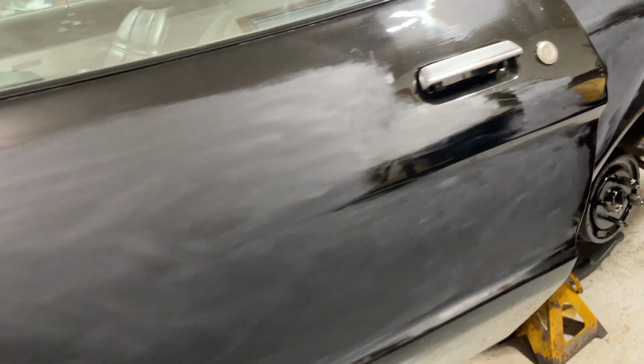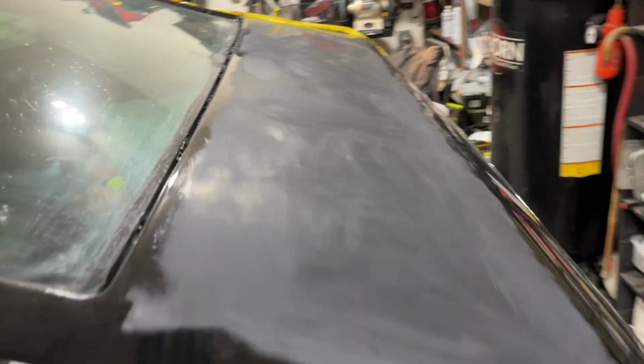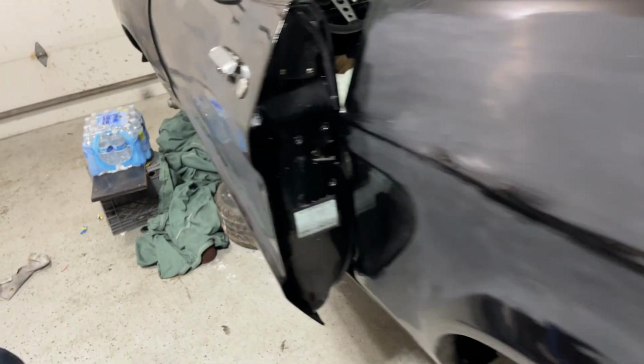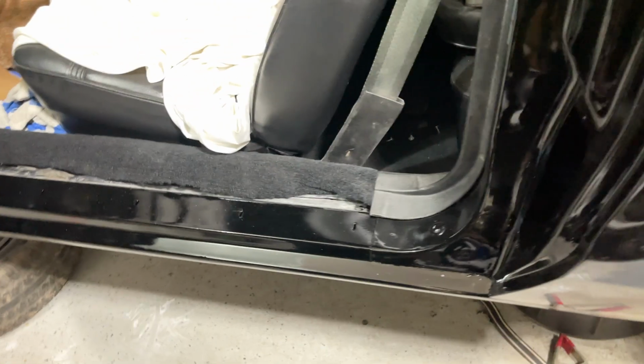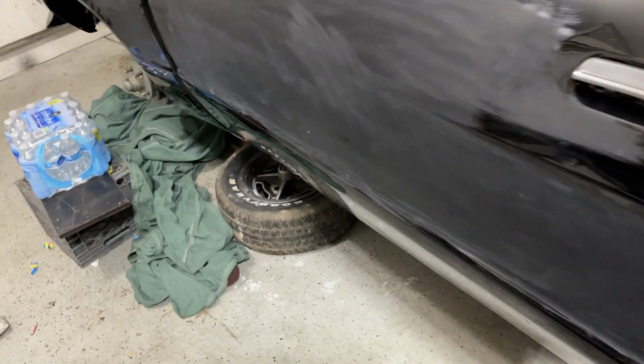This side is completely done as well. And the hatch part. There's a spoiler that goes here, so I wasn't focusing on that either. Just the main part, to get everything sanded down in one direction. This as well. All right, so this is next. If you wanna stay tuned, subscribe to the channel to watch this. I'll be in here in a couple of days, taking the 1000 grit off. You guys can see it's one way, so I'll be going this way with some 1500.